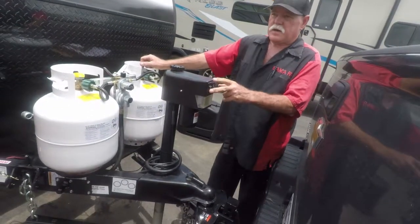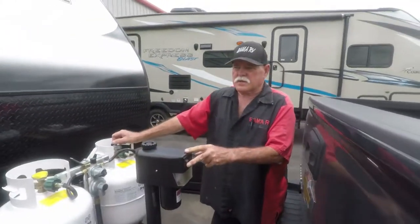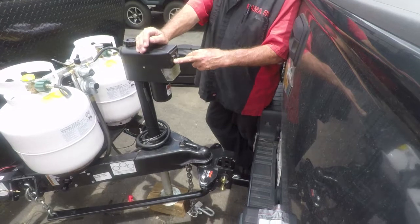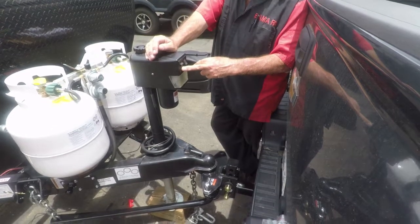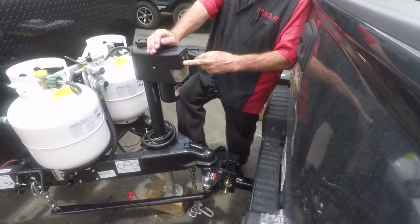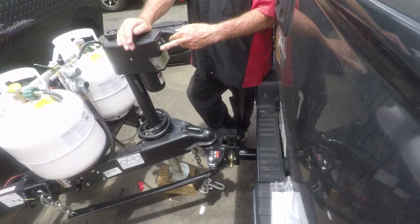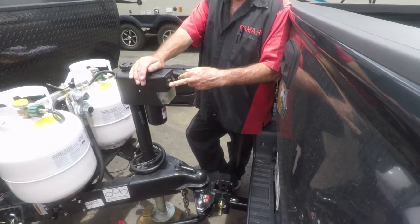Get you a block like that. You want to get it up where you're sitting high like that. Okay. It's easier to put on. Yep, kind of a little bit like that. If you try to do it on the ground, you're never going to make it. Okay. It's just too hard. Always bring your jack up towards about the bottom of these right here. I wouldn't bottom it out. I'd bring it back to the bottom of that. That way, if it drags, you done went too far down something. That's not a good sign. No, that wouldn't be a good sign.